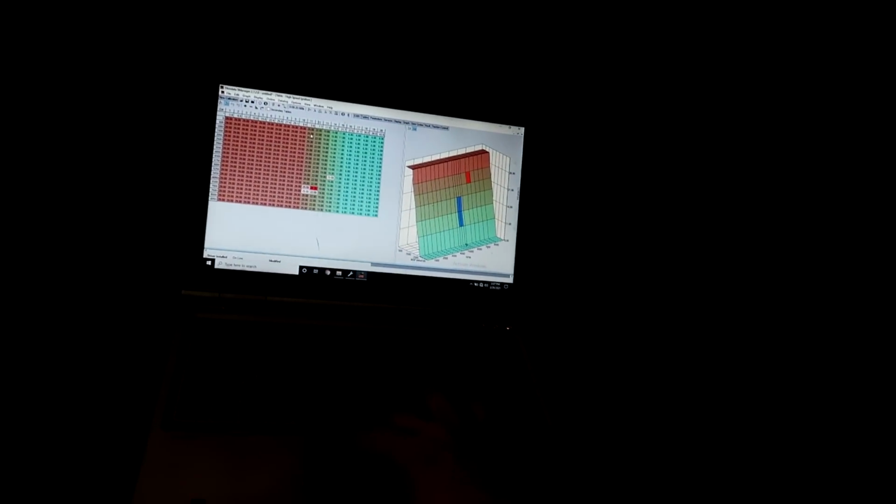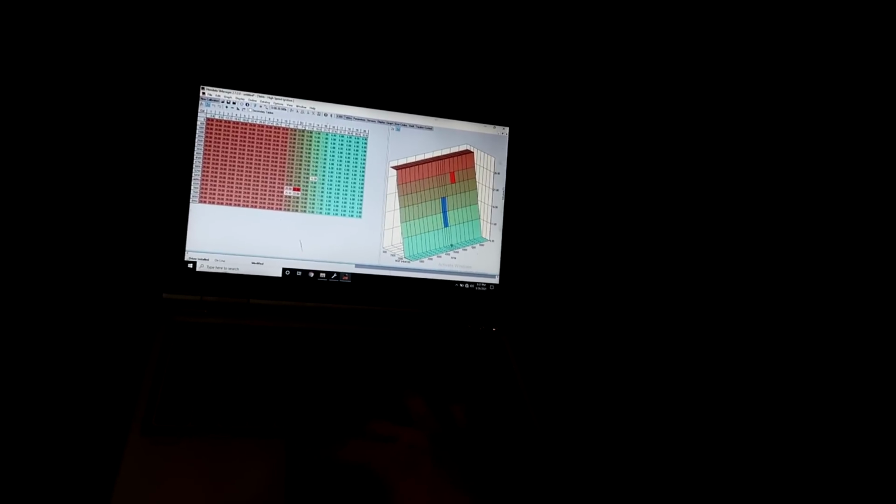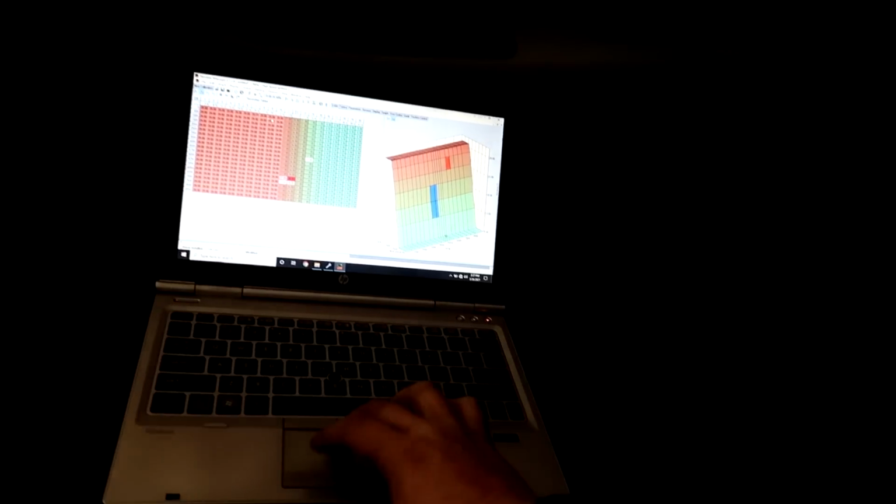Okay, and another thing that you can always note is if you put ignition timing in a car and it drops boost, which this thing lost about a half a pound of boost and picked up 25 horsepower from adding 2 degrees. So that's another indicator that the engine's just a little happier overall. So we're going to try a little bit more ignition here, kind of see where it ends up. This is always my weakness. I always start off way too conservative on ignition timing.